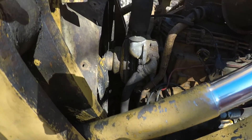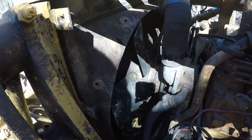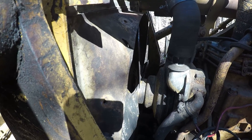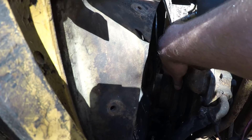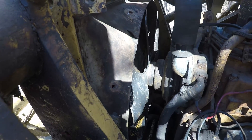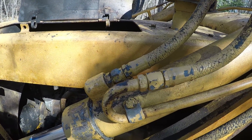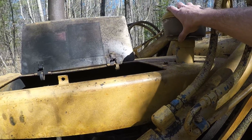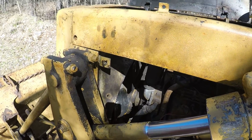This is a view from the other side. The water pump is right behind here and the fan is right here. It has four bolts on the front of it — as you can see, it was quite a tight fit to get those bolts in and tighten them. It was even more difficult with the fan in the way, so I had to move the fan all the way down so I could get the water pump back on, put the pulley back on, and bolt it in place. To do that I took off this hood, which has got to be maybe a hundred to a hundred and fifty pounds of steel. I also had to disconnect the air filter and take off the exhaust pipe.